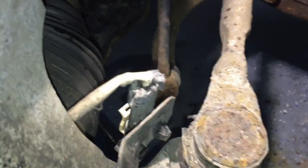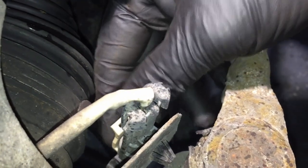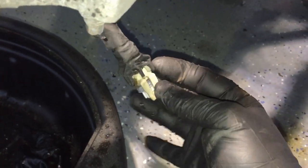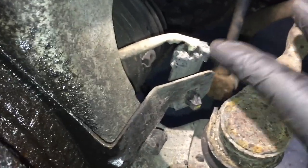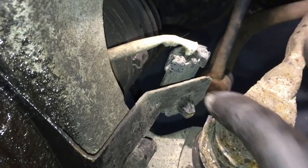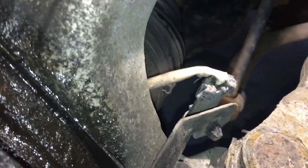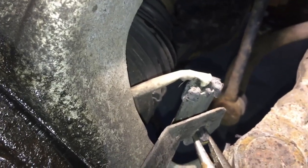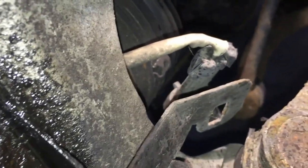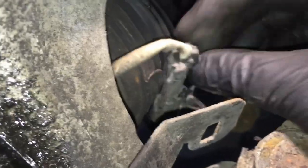While that's soaking, go ahead and pull off the ABS connector — it's right here by the tie rod end. Pull the clip off and that'll free the factory harness and move it out of the way so you're not hitting it. There's also a short pigtail that comes from the hub and bearing we're changing. Compress the clips and push it through so it can separate. You can see it's just a V-shape and it snaps right in — press the clips and it'll come right through.